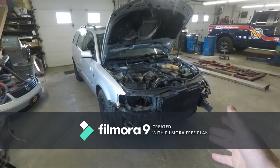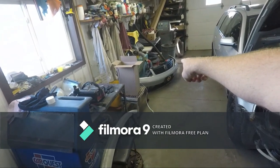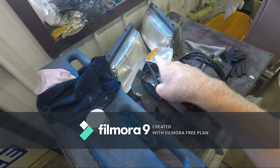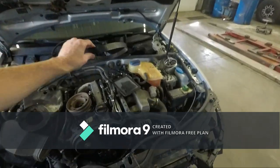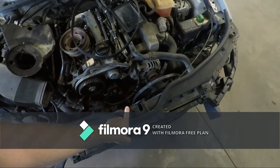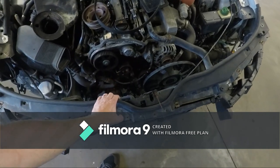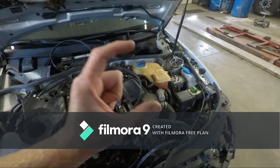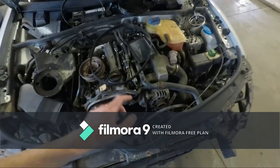This afternoon I jumped into this while I was working, so I really didn't have time to grab the camera and show you everything we did. You'll notice the bumper cover is sitting over there, the impact bar is here, and we've got the park lights and headlight sitting on the bench. We removed everything here to give ourselves room between the engine and the rad support — otherwise you've got about two and a half to three inches, not enough to crank on wrenches.